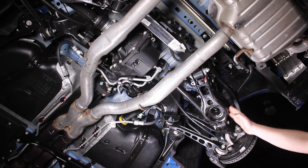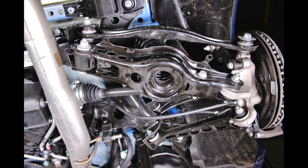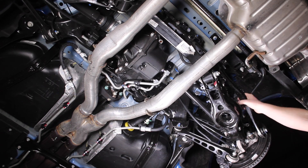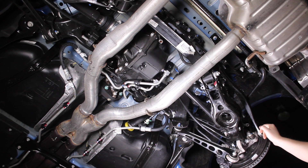The main lower control arm is similar to other rear multi-link suspension setups. It supports the spring and the shock, and up front at the knuckle it features a pillow ball bushing for less binding as the suspension moves, for a little bit better handling. On the Camaro SS — especially with this package — it features this toe link that controls the toe of the wheels, and it features pillow ball bushings on both sides for less binding and no toe changes as the suspension goes up and down, which will also affect handling.